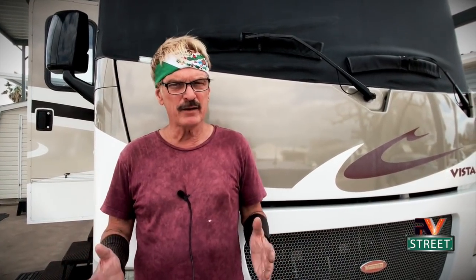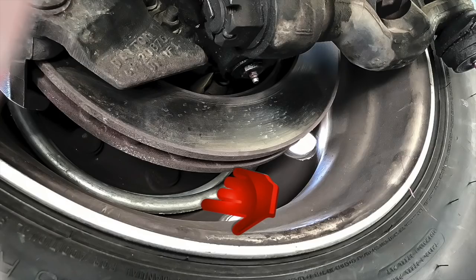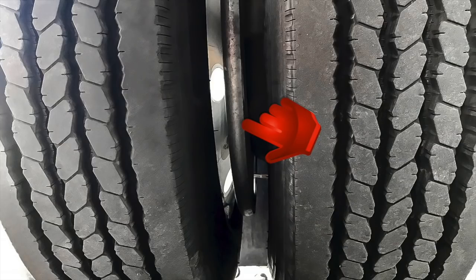For me, I like to do everything with a little bit of overkill. So when I buy new tires, I go ahead and have them balanced with lead weights as an added precaution — I like to have those tires as balanced as possible to start with. Then I put on the Centromatic rings, then put on the rim and new tires. With Centromatic rings you never have to have your tires rebalanced, and it's easier on your suspension, kingpins, and bushings — having balanced tires is going to be easier on the whole entire drivetrain. You'll need four rings: two go on the front, and on the rear duallies they go in between the two tires.